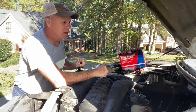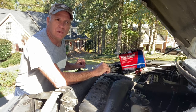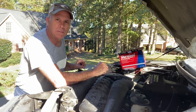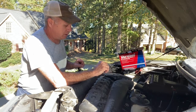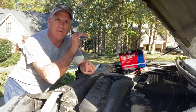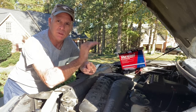Just an update on the 2007 F-150 with the 5.4 in it. Remember last week we were getting codes P0300, P0303, and P0307, and all indications were that it was the camshaft position sensors. We swapped those out and while the truck ran much better, under a load going up a hill I was getting a bump when pressing on the accelerator, and under a really heavy load on a steep grade it was just constant.